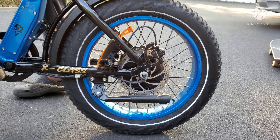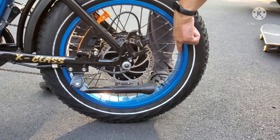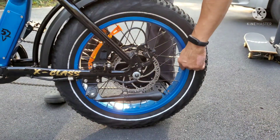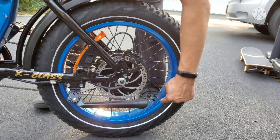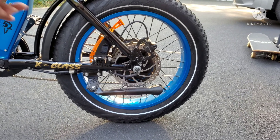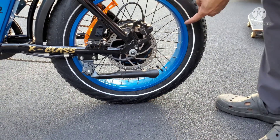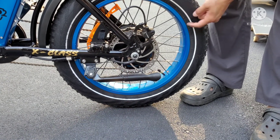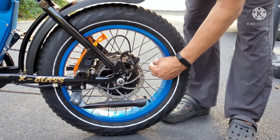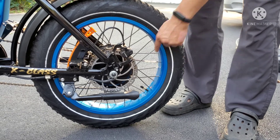The most important part is that you don't want to bend that rim, and also don't torque it so much that the nut holding the spoke into the rim pulls out of the rim — because this is all soft aluminum, it's thin material, so be careful. What I did: I stand on the left side of the bike and push the wrench away from me, which tightens the spoke nut. So if this were the nut going into the spoke and you turn it this way — push it away — that tightens the spoke. I did that to every one of them.